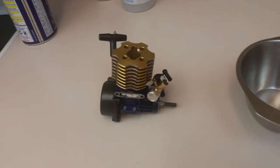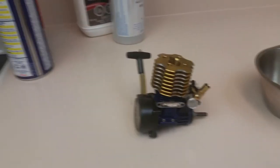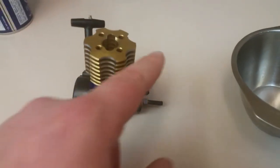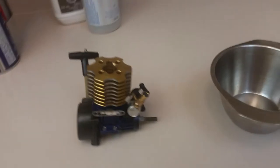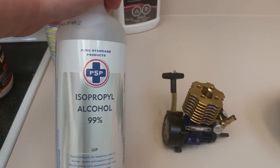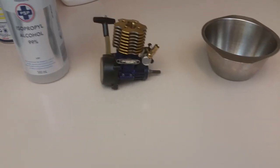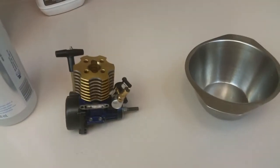When it comes to cleaning the inside of your engine, clean the outside first so you don't get any dirt on the inside. Take your carburetor off — note the direction of all your parts, take pictures. Take your cylinder head off, take off your pull starter and back plate if you have one, get the crankshaft out, piston and sleeve out. Use a fresh clean container. Make sure your hands are clean and use a different toothbrush, because if any grit from the outside gets on the piston, sleeve, or crankshaft it'll destroy your engine.